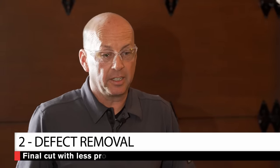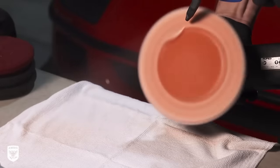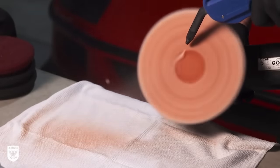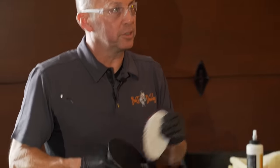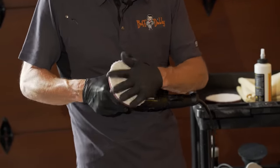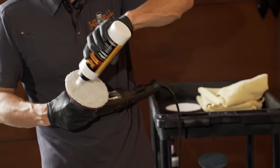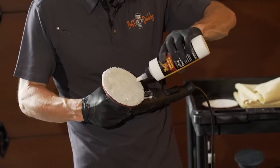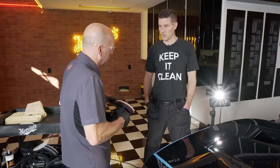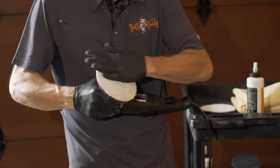And in this case, if you have compressed air, clean the pad you're using and eliminate all that extra buffing liquid. And if you don't have compressed air? It's very simple just to change the pad. And again, in the case of these microfiber pads, it's best to apply some of the buffing liquid and we have to season or prime the pad. And that just simply means spread it around. Make sure it's moist, make sure that it's distributed evenly.